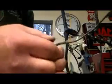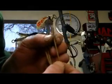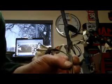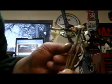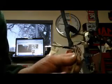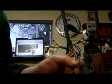Quick note about the colour coding on some of these old Austins, etc., British cars. I don't know about any other makes, so I can't talk about it. But when you're working with your wiring loom, you may or may not be able to see this, but most of the cables are all black, covered with a cotton wrapping which has got the colour on it. Like this one here, it's pretty manky and dirty, so you've got no chance of seeing what the colours are. It's a good idea, if you're getting it cleaned off, not to rip all the wrapping off first. Once you've spotted what colour it should be, like this one's a white with a green tracer, mark it up as what it is, and then you've got a chance later on.